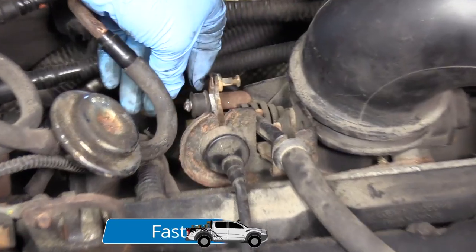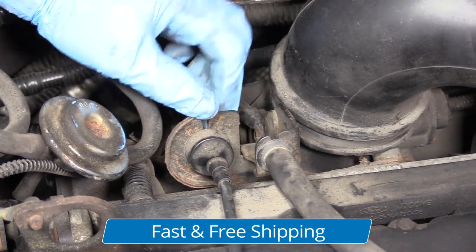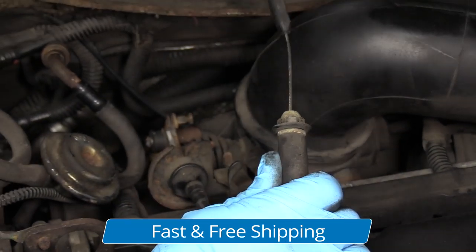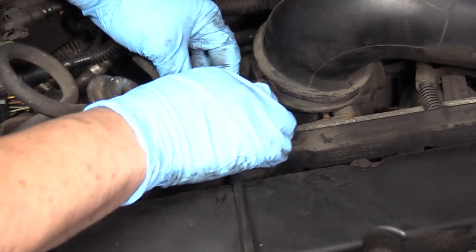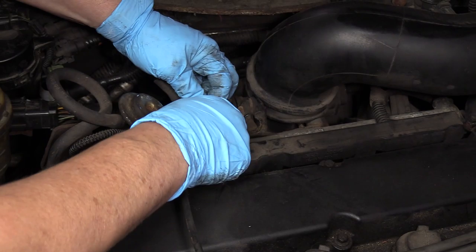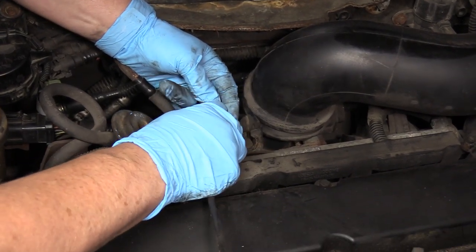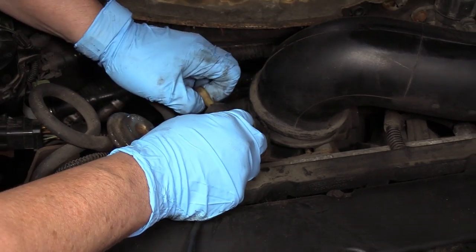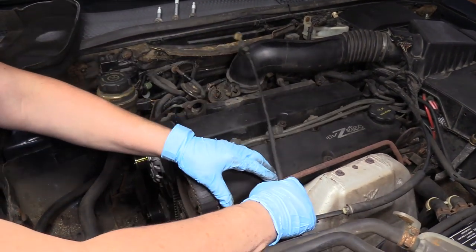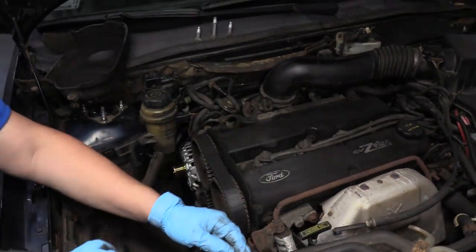Once you've taken the banjo-style one off of the rubber bushing and under the slide clip, you're just going to grab firmly and kind of pull it up — it comes right out. Same with this one, just grab and pull out. Now that rubber piece, the grommet, will fit through — just wedge it through and pull the cable right up. Now you can just follow your cable and undo any brackets or clips where it's attached. Just get it out of your way.